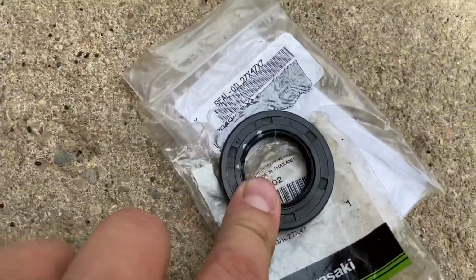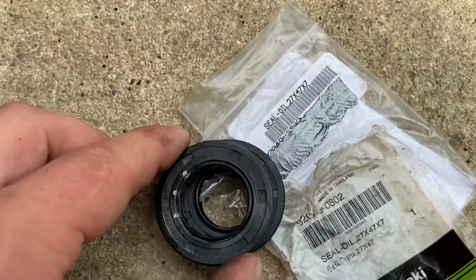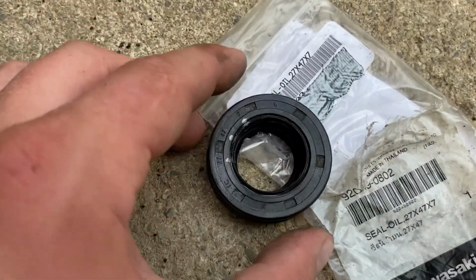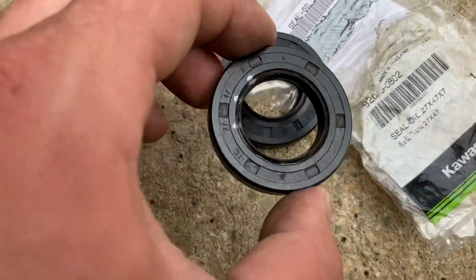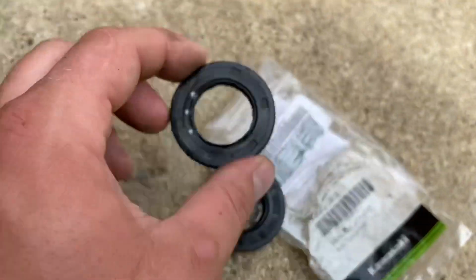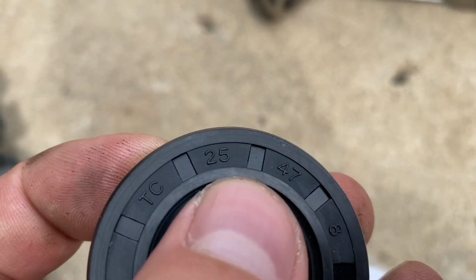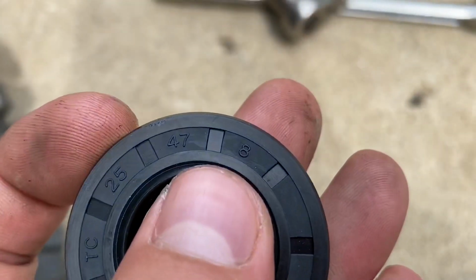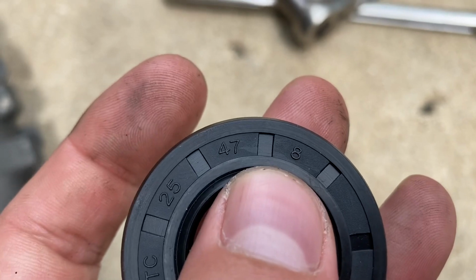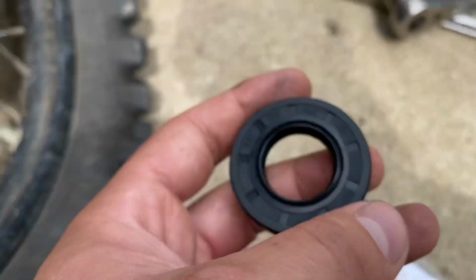So this is the original seal out of the bike, and this is the new seal. You can see it's got a lot more meat to it. And that's because the inner diameter has a difference of 2 millimeters. So this is 27 inner diameter. This is a 25 inner diameter. So this stuff will all be linked in the description box below. I also got one that's a little wider because a wider one will actually fit on this side. So it's 25, 47, 8.